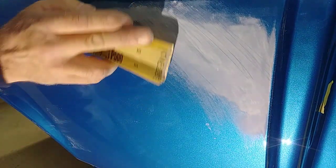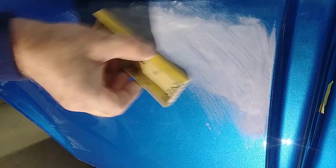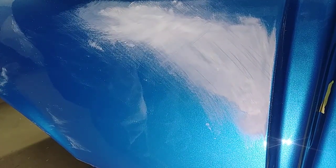And this is going to be flat. Needs to be fully cured. If you don't think your paint is fully cured, or if you have a question after you cut it out with 320, get that heat lamp back on it, get it back out in the sun, get it fully cured. Otherwise, you have a chance of getting a ghosting run showing up because it wants to cure later after you sand and polish it.